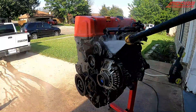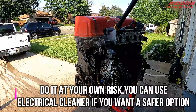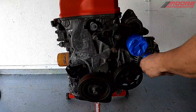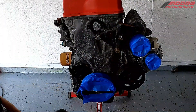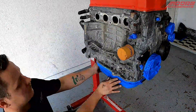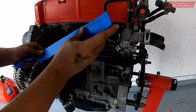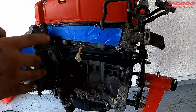You may have an issue if it's in the car while the car is running or something like that, but this engine's not going to be running any time in the near future, so it should be fine. Then I just basically let it dry and get it all taped up. I start with the pulleys and stuff like that. I'm not too worried about the water pump pulley because I'm going to be replacing the water pump. I tape up all the connectors, a lot of the oil pan, the valve cover — you can just take the valve cover off, but I've already bought the tape so might as well use it. Tape up the intake ports and the exhaust ports and basically anything I don't want painted.